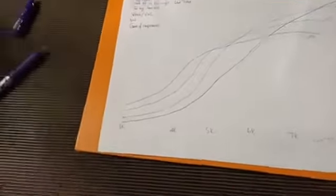Okay. The other thing is people say, how come you run, say, 256 inlet and 264 exhaust? Or different split camshafts between inlet and exhaust. Look, most engines are designed so that their inlet and exhaust flows are balanced. So generally, the same type of duration and lift is required in both, or they're going to be very similar. Some engines where they've got restrictive inlets may need a different cam in the inlet, and the same with a restrictive exhaust system.